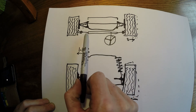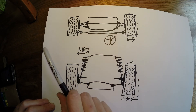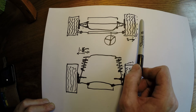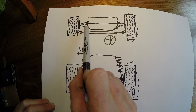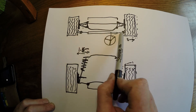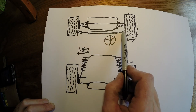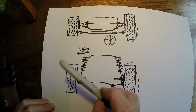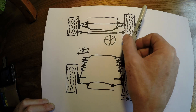Likewise, more importantly, you could end up with a situation where the steering goes out - 3mm of play could mean that you end up with toe-out or toe-in across the back, because whilst that's moving at the front, it will also affect your steering, because the steering isn't being flexed at all. It stays in a solid position wherever it is at the time. Because the front is moving and the back doesn't, it'll either pull out or pull in.